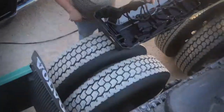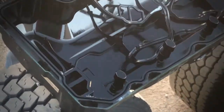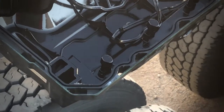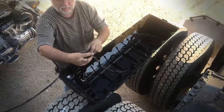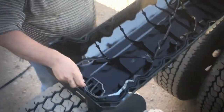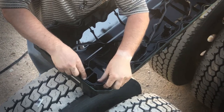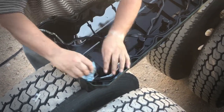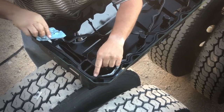Now, the gasket. I already cleaned up the trough, and the back that has the silicone is right about here. The valve cover gasket goes like that. I'm going to put this part in first, press it in, and ensure that there are no breaks in this piece here.